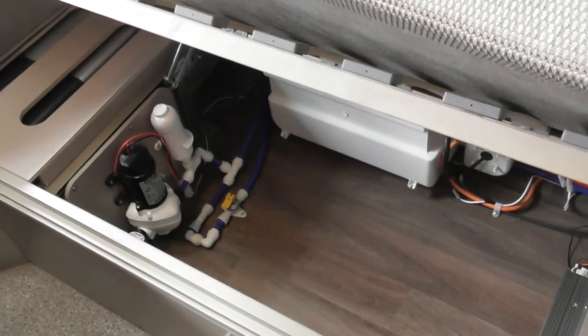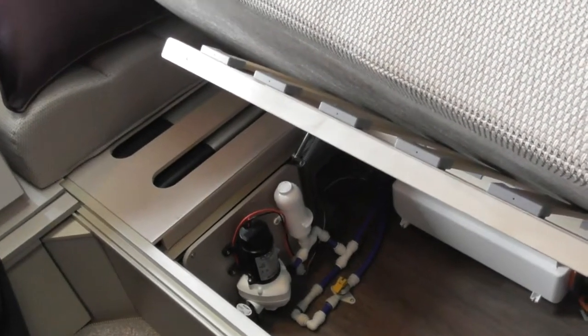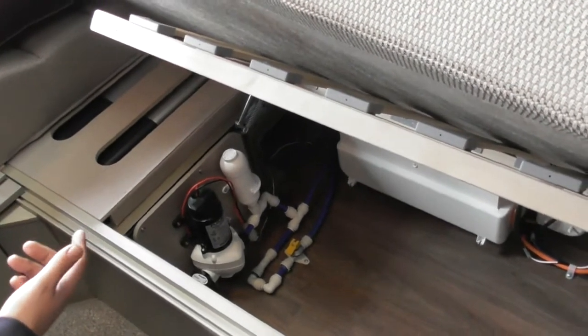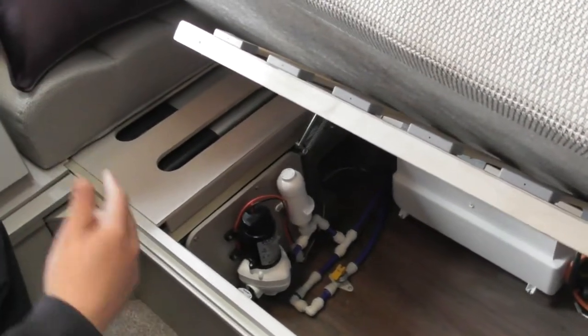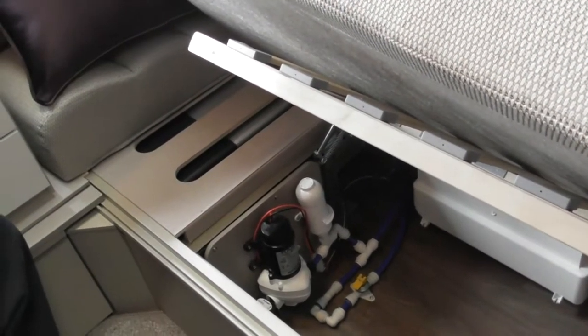your drainage tap. So when it comes to winter time, or even I tend to drain mine down when I'm finished. I always drain it before we leave the site. All you need to do is lift that up in the air, leave your taps open, and then all your water system and that boiler will simply drain straight underneath your van.